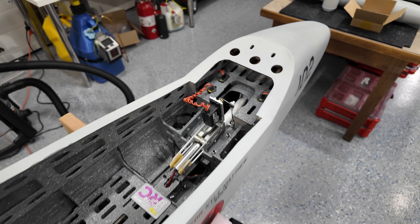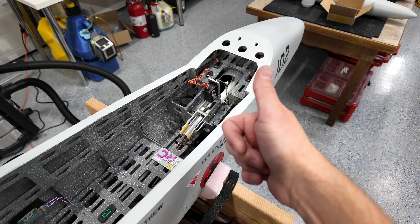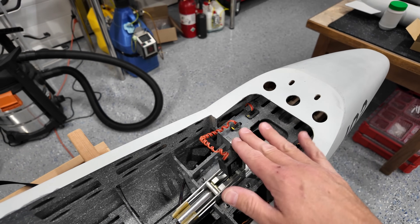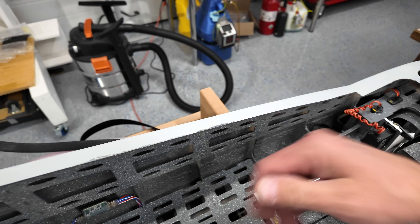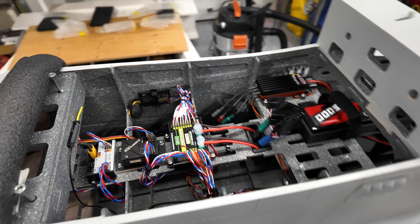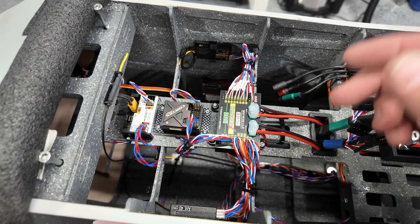The front gear is back in. Everything's working awesome — I've cycled that about 15 times and it works beautifully. No issues there. We've got everything plugged back in, connectors and everything run. One of the final things to do is go through and shoe goop all of our connectors — that's something we do on planes. Haven't done anything on this one yet.